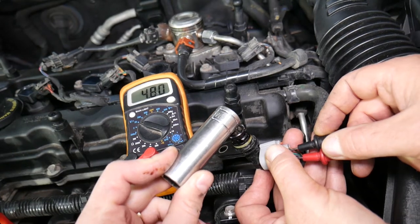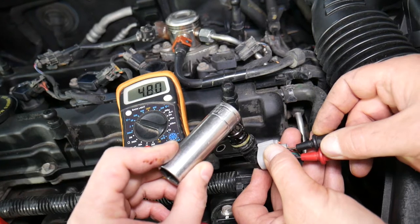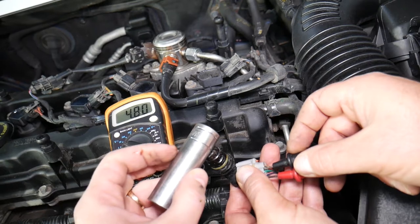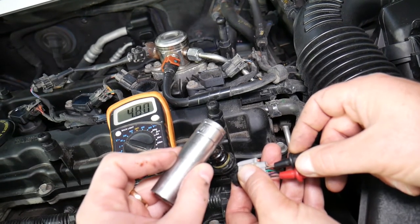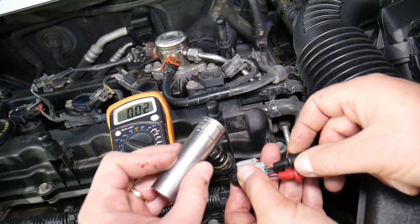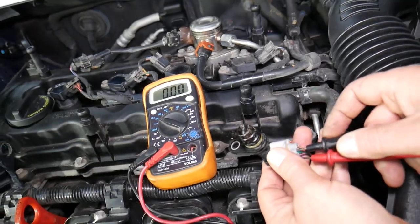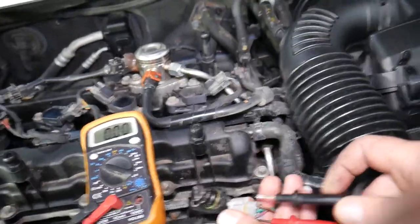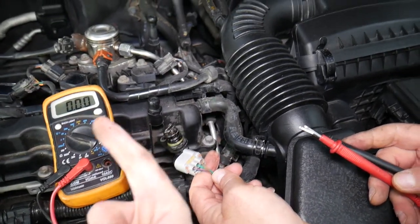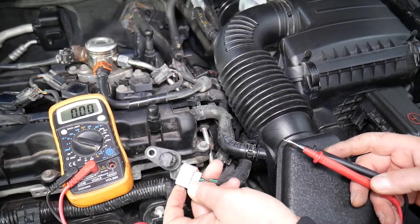You may also have a bad fuse somewhere. When finding the magnet spot on the sensor, you kind of feel it — if you come a little bit sideways it doesn't work, like a magnet pulling metal. So that confirms a good working sensor. Make sure you don't touch the two wires together with the probes, because you can burn the fuse for the camshaft sensor or even cause damage to your engine computer.